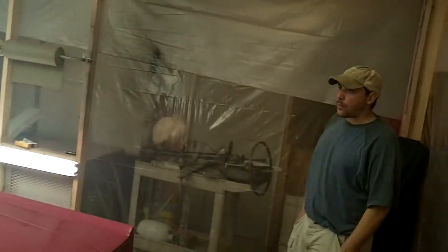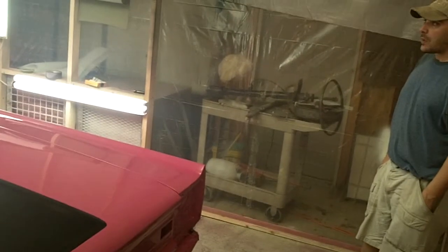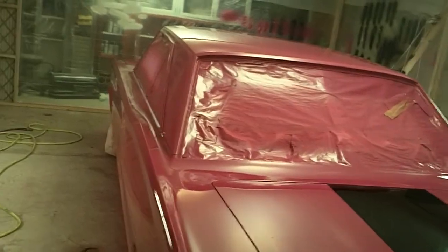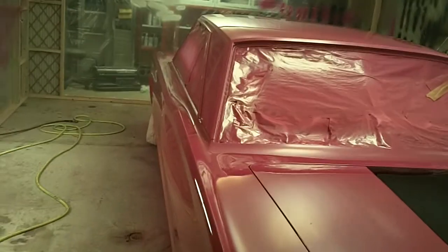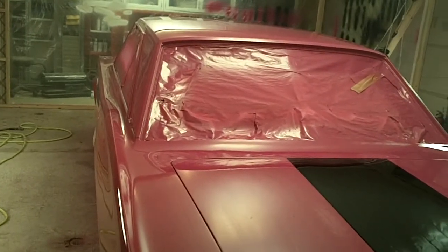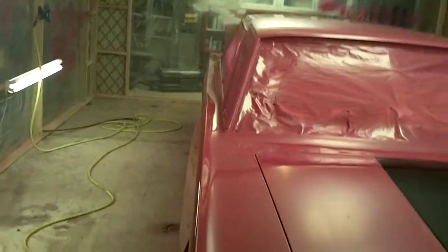If you were going to build a home-built paint booth like this, what else would you do other than the airflow issues and the lighting? Mike says maybe space out the machines. I was shocked when he fired up that Iwata spray gun — the clear coat fog was so thick in here that if you were standing at the trunk, you could not see the nose of the car. If there were any bugs in here, they're probably clear coated to something right now inside this room. It really didn't move the air across here anywhere near what it needed to.